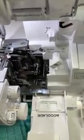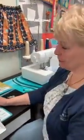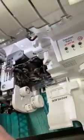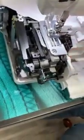There was something else I wanted to show you. On the Accolade, this door will open, which is really nice — I've got some dust back in here and my little brush. That comes with it — I just want to keep that dust cleaned out. The nice thing about this one is you can kind of blow and it will go out that direction. Normally you don't want to use any air in your machines because it just compacts it down inside, but with this one I have a little more leeway because the door is open.